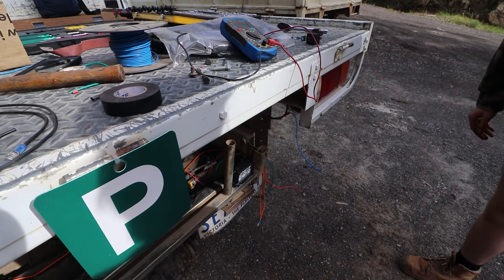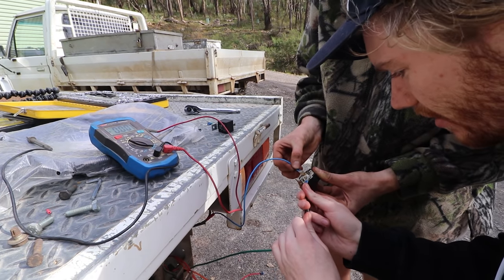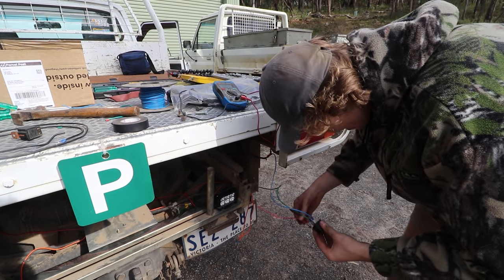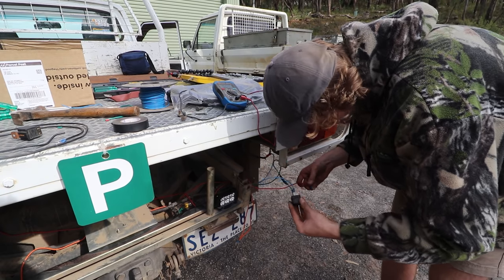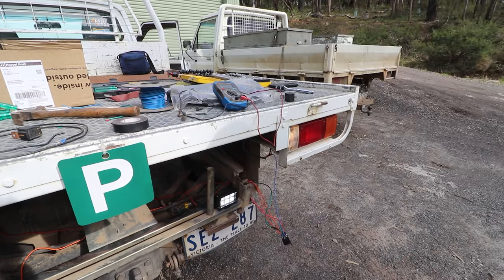So it's a relay issue. I've got one more relay in my car I can try. Touch ground on the one opposite to mine. Yep, you can hear the relay. Wonder if this one will... Yep, this one works. And then power goes into 30, and then these work. Yes! Finally! So it's a dodgy relay.